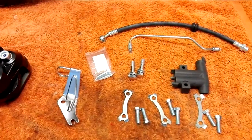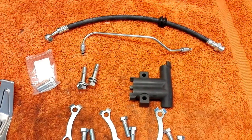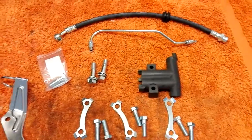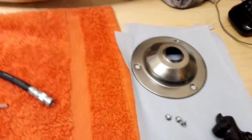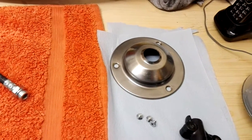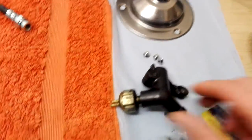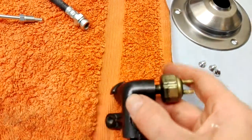Those are most of the parts. This one is the twin splitter to feed the discs. You can get away with using the old splitter, add a longer bolt and put both hoses off that, but it's a bit of a bodge and not that expensive. Here at the top, that's the dust cover for the front wheel which you are going to dispense with. You don't need that because you're going to put a disc where the cover used to be. Also this is the original brake splitter — it's only for single use. And on the right there, that's the brake light switch.